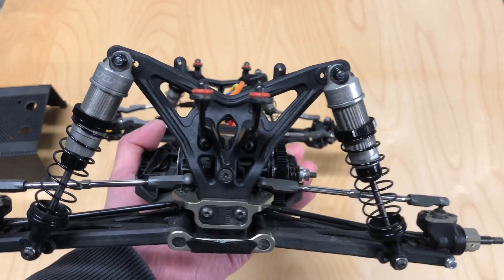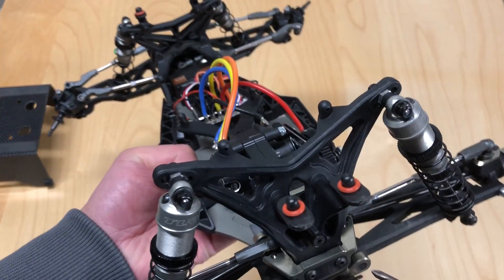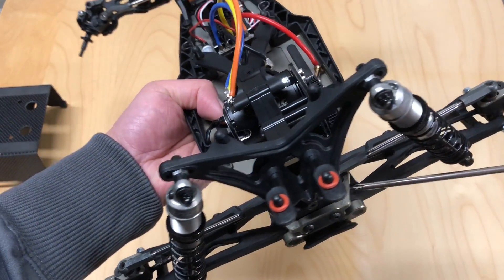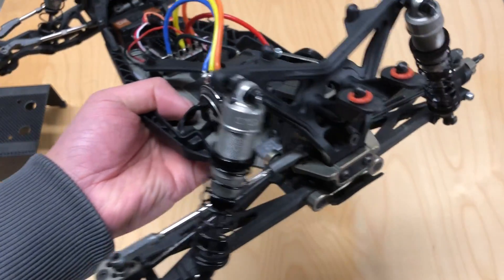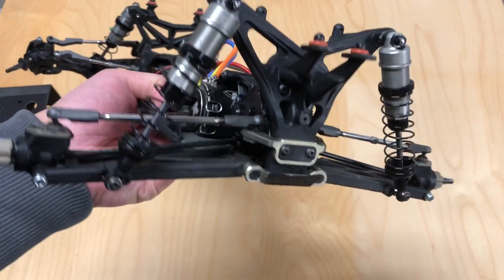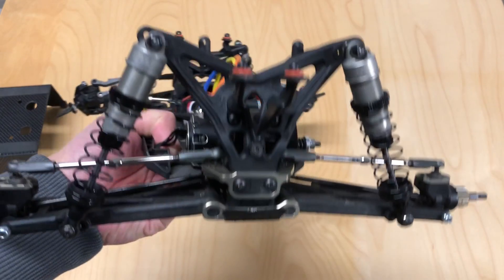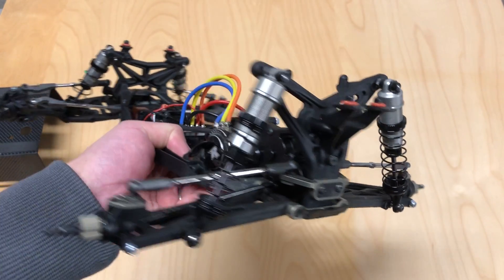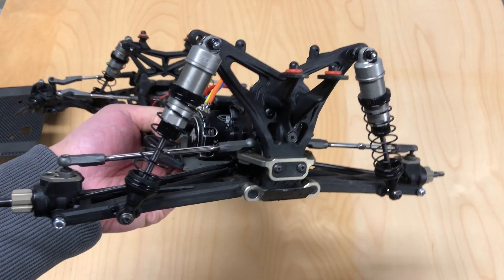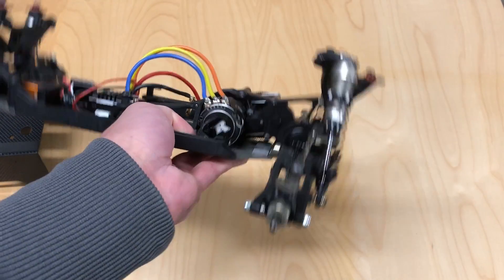Another thing I did was run the 4.0 rear camber block. This actually has mounts for both mounting shocks on the front of the arms and also shocks on the rear of the arms, plus a couple of different half-hole adjustments. The 4.0 camber block will actually mount right on as well — you can do that with or without the rear shock mount. Anyways, the parts mount right on. Thanks to Frank Root and Wally RC from RC Tech for giving me the idea and confirming what parts I needed. I'll put the part numbers in the description below. It's a nice cheap little upgrade for your 3.0 to get a little better handling.